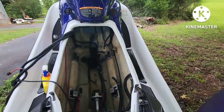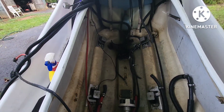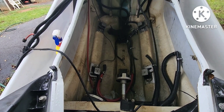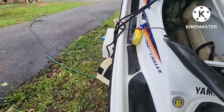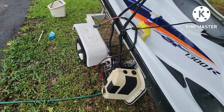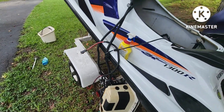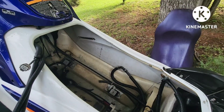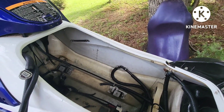I don't know how much better the inside is, but it's got kind of a yellowish tinge — but it's clean. Tilt it and leave it to drain. I moved all my electrical out of the way and tried not to spray it directly — I don't want to create more problems. I'll go back and WD-40 all my connectors; that'll get any water I sprayed in them out. Of course, I'll give them time to dry.